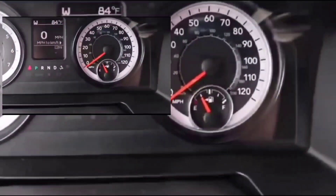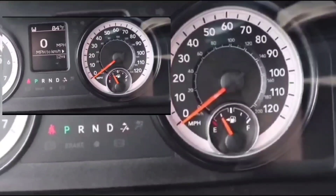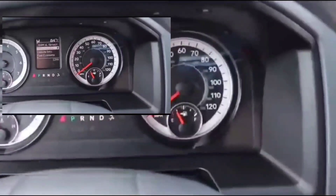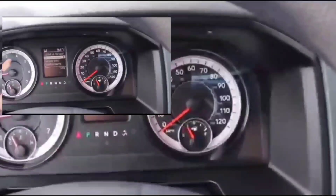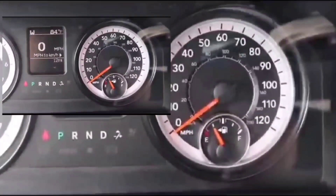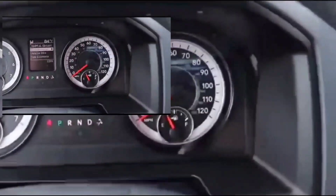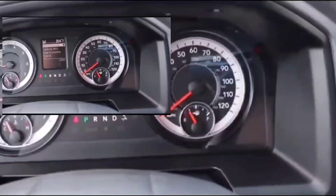I was a little worried — maybe I left the lights on. So I turned my headlights on and went out to check them. If you want to check your battery, just turn on your headlights and look at them — if they're strong, chances are your battery is good. That's not always the case, but it's a quick check.